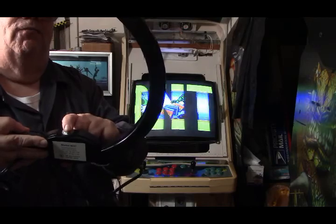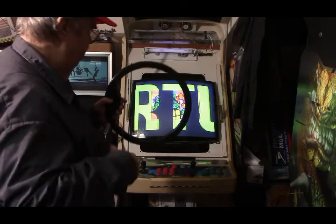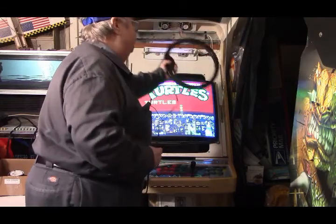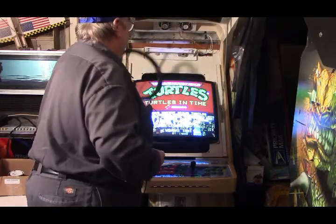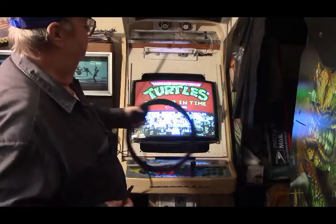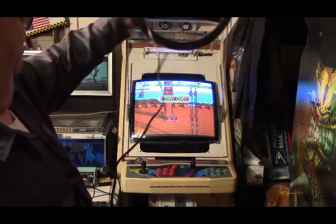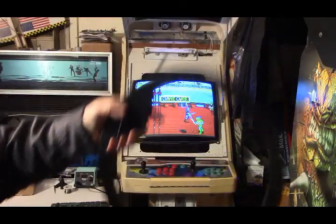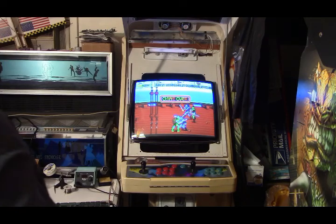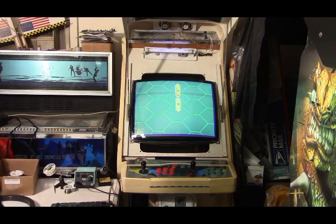Here it is — it's rather large. It's got an AC cord so it plugs into regular AC power, and it has a push button you hold down for it to energize. The way you use it: you plug it in, hold it up close to the monitor, push the button, and swoop it around the monitor in a circle, gradually pulling it back farther and farther. It'll even affect the picture way back here. Once you get it far enough away, you let go of the button — and supposedly your monitor is degaussed.